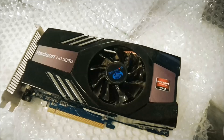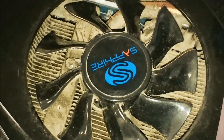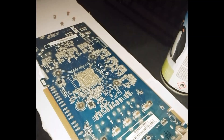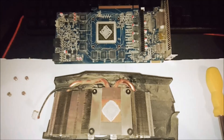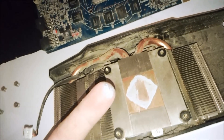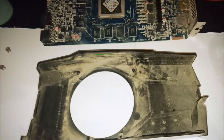After the preliminary benchmarks were completed, I removed the card and took a closer look. The first thing that was immediately noticeable was just how dirty this card was — it was disgusting. It had obviously never been cleaned since it was purchased new; there was hair, there was dust, and everything was completely clogged up. Stripping it back was really quite easy — removing the heatsink and plastic shroud only took four screws. Once separated, we could see that the thermal interface material was extremely dry; it basically came off as dust in your hand and was doing absolutely nothing.